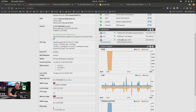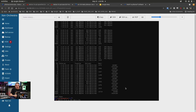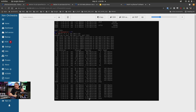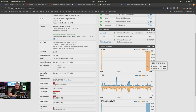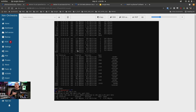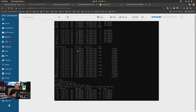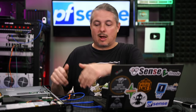These systems have no problem talking to each other at 10-gig. I've been doing a series of tests - we'll up-arrow this and you can see I'm running iPerf and we're getting 10 gigs a second. So yes, it does 10-gig, but you may notice that I broke it up into multiple streams. While you can see the 10-gig connection absolutely doing its job, what happens if we do a single stream? We know we get 10-gig with multiple streams, but if you do a single stream, this is where you start running into some processor limitations. A single stream - as in one dedicated stream from point A to point B routed through this system - can do 4.67 gigs. But once you start having multiple streams, you can have more than one stream doing that speed until you hit the overall limit of 10 gigs, which is now hitting the physical port limit.